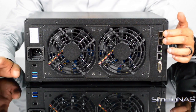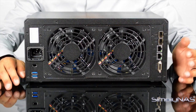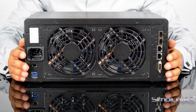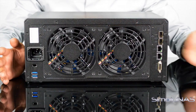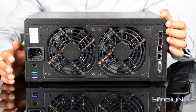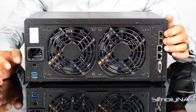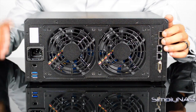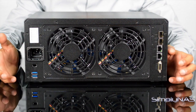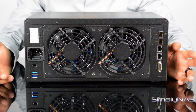This is the first time a NAS has come ready with 10GbE installed. It's a big plus for businesses and enterprises that use 10GbE — this can be a great backup unit for your servers since it runs on 10GbE and won't be slow at all. You'll get great IO and can back up your virtual servers using Veeam or similar tools. This is the first Synology NAS to include 10GbE installed; currently it is limited to SFP+ only. The back of the unit is very minimal — eSATA has been completely removed, but eSATA is an old technology we don't use much anymore.